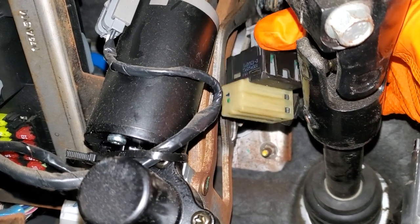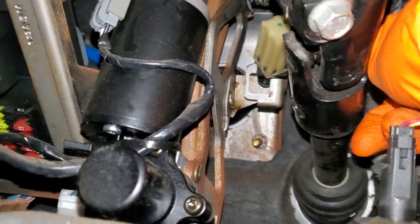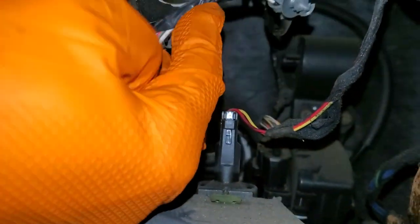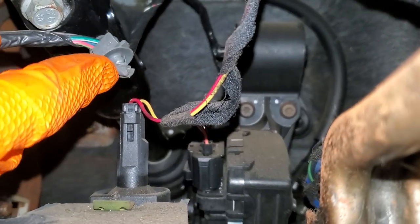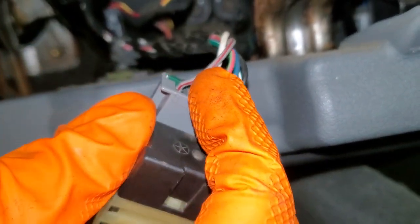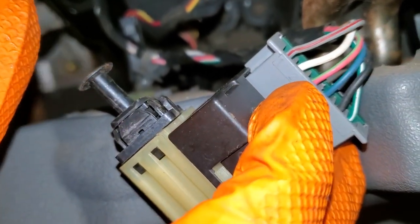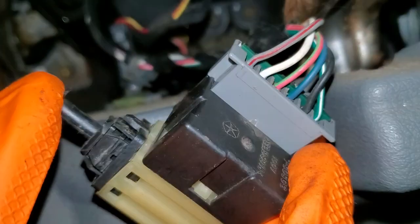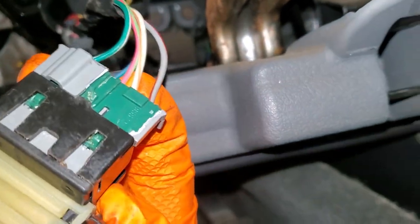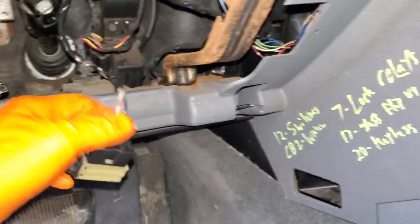At this point it's still connected to the harness, so it won't really move all that much. I went ahead and detached the piece which holds it further back just so I can get the harness out to where I can get my camera on it. Now, that power from that fuse comes in on this gray-red wire, and when you hit the brakes it allows the plunger of the switch to pop out. When that occurs, the brake light switch sends the power from the gray-red wire to this white-brown wire, and from there it goes to a couple different places.